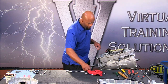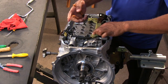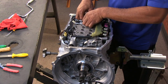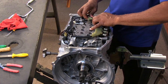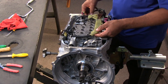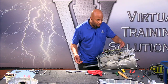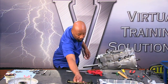There are a couple of things to keep in mind when taking this harness off. There are little squeeze tabs that come in — they almost show you what you need to do. They kind of reach out with their arms wide open; you just squeeze them in and the harness pops up just like that. This unit is very service friendly — that's something I like about it. Then there's a little tab you have to weasel out, kind of like a threaded hole that it pops into, a quick push type deal. Get that out of the way and the internal harness is out.